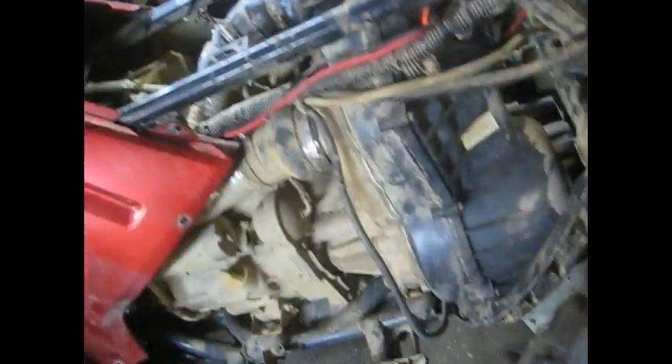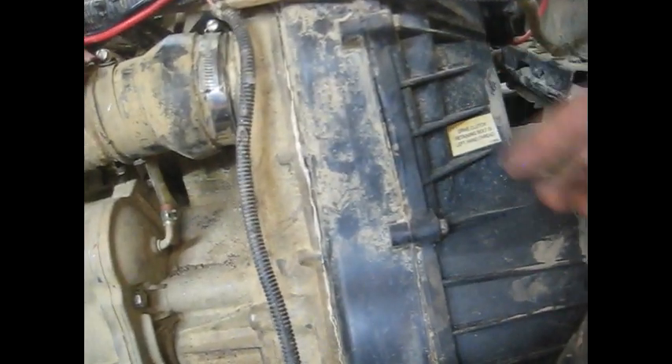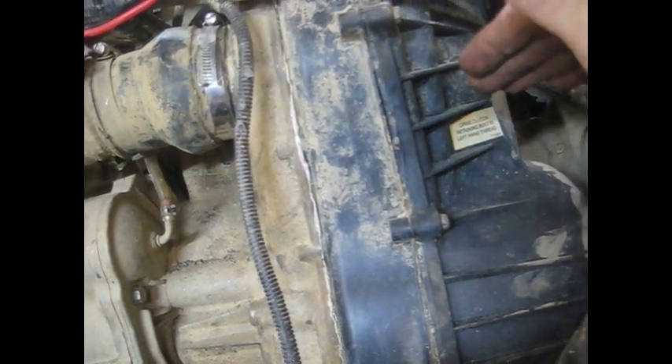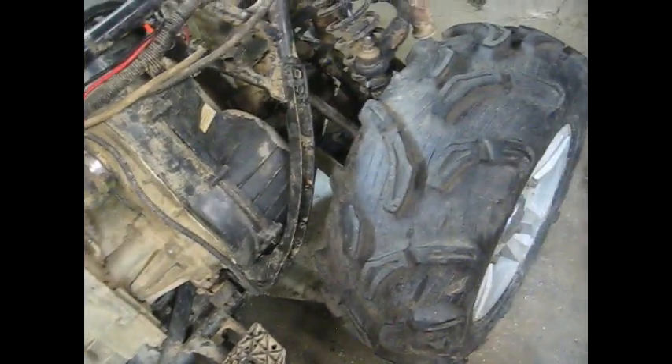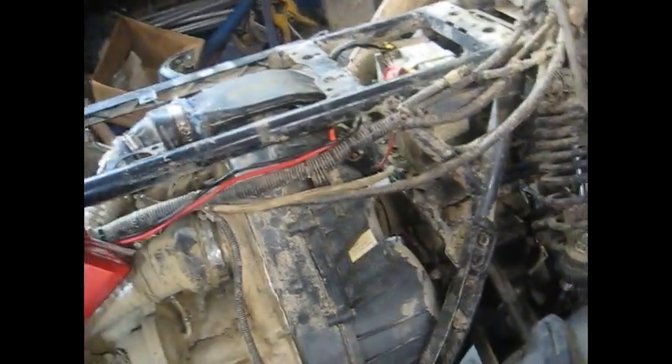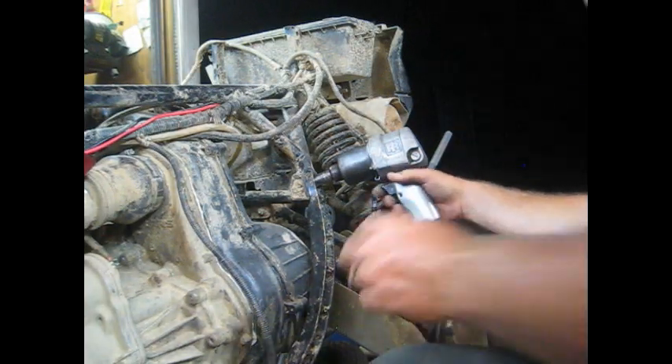What we want to do is get in here - I think I want to take the cover off and see what the clutches are doing. It almost seems like the clutches are engaging and spinning something in the transmission, and then something in the transmission is slipping. I need to jack the rear of it up, take this left rear tire off with a 17mm socket, then remove this brace - I think those are 15mm. Then we'll look at taking the belt cover off.